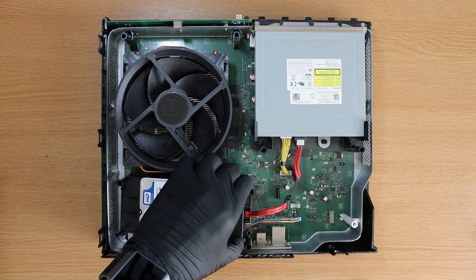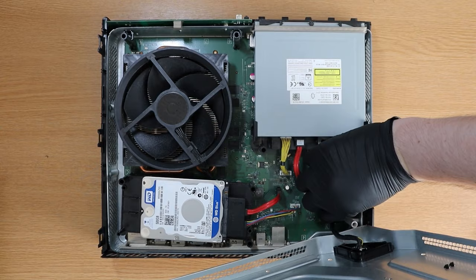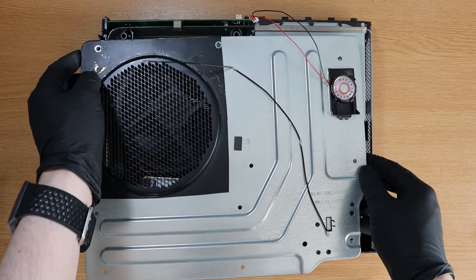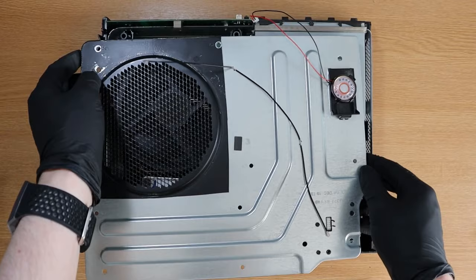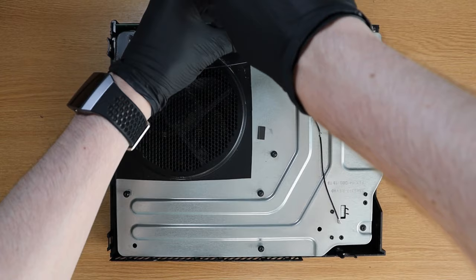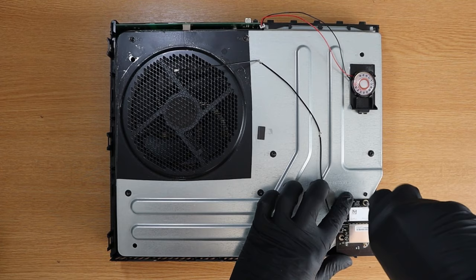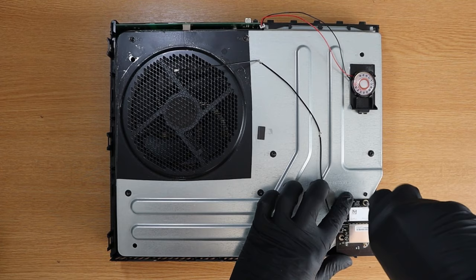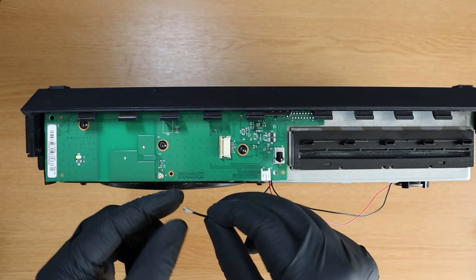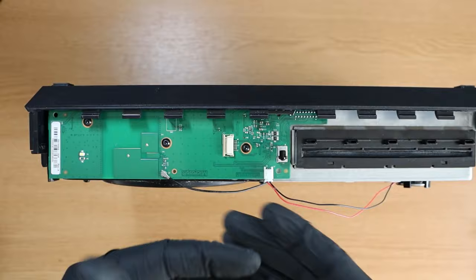Now we're going to work backwards to putting your Xbox back together. If you did remove the hard drive, make sure this sits correctly on the motherboard, then plug in the data cable and the power cable. Next, plug in the Wi-Fi card's cable back into the motherboard from the case. Now place the eight screws that you took out earlier back in the same spot. To help you, on the casing the character C followed by a number is where the screws should go back. Now take the Wi-Fi card and put it back in the clip - don't force it, it should just fit nice and simple. Switch back to the Torx 8 screwdriver to do this, screw in the screws, and put that antenna cable back on the Wi-Fi card. Put the antenna cable back into the front plate and do the exact same with the other cable - that cable is for the sound when you turn the Xbox on and remove a disc.